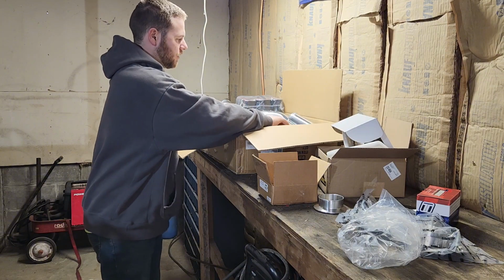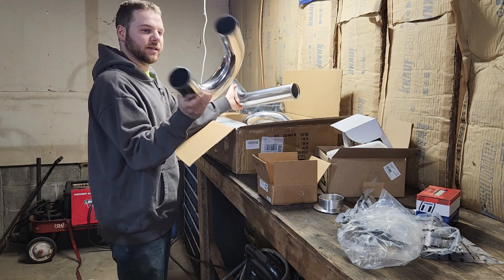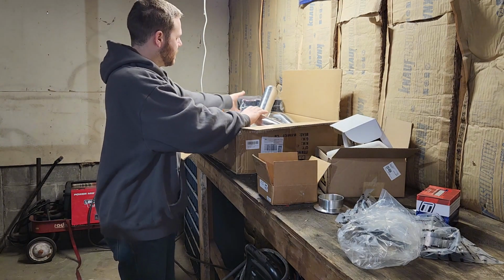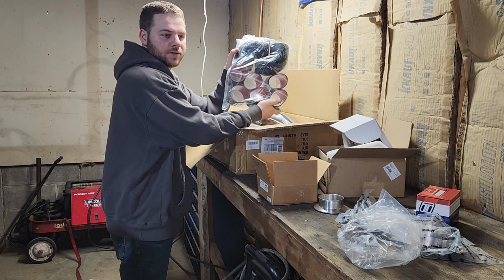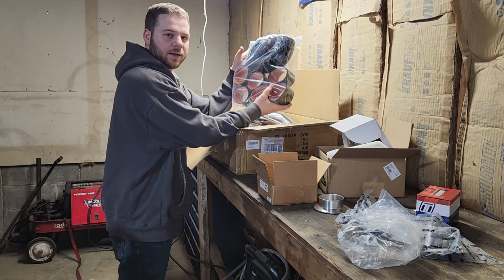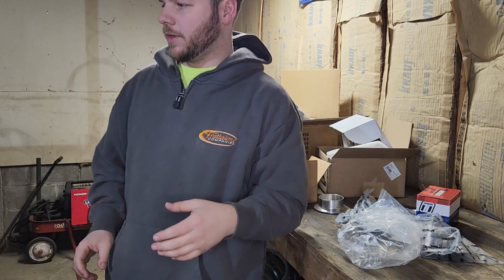And then I got Amazon. I ordered a kit of 3-inch aluminum bends. Bunch of just miscellaneous. There's U-bends, there's 90s, there's 45s, there's some straight pieces. And then also it came with a bunch of rubber connectors to it. So we'll be combining a little bit of the rubber and the V-band clamps because we do still need some flexibility between the chassis and the engine.